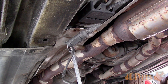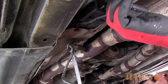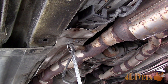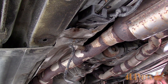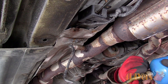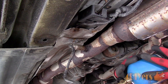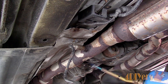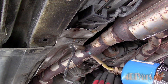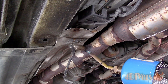For replacement, depending on the age, these can sometimes be a pain to replace especially when you don't have an acetylene torch set. Right before I remove the sensor, I will warm the vehicle up. Typically a catalytic converter operates at around 650 degrees Celsius or 1,200 degrees Fahrenheit and that sensor is usually within close proximity, so we have plenty of heat to work with. Both rust and soot will cause the sensor to seize, so the heat allows for the bung to expand so the sensor can be removed. If you rather use a torch, that option will also help. Here I have a small propane powered torch, easily obtainable and cheap to own. The tip of the blue flame is the hottest point and that needs to be touching the bung — the threaded portion the sensor screws into. If you are still having issues, use a high quality penetrating oil. You can let it soak overnight and apply it more than once, but keep in mind some penetrating oils are flammable so have a hose or fire extinguisher handy.